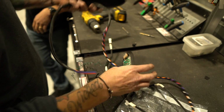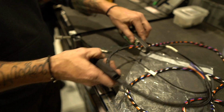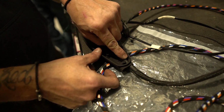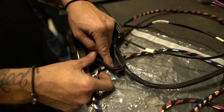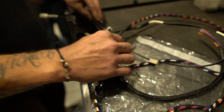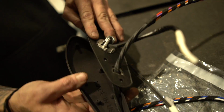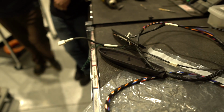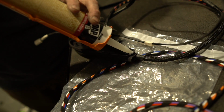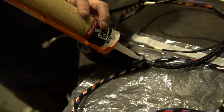Okay. We start to get down to it here. The sealant that you're going to apply, you're really only going to put it around the wire that you ran in and the other hole if you're not using it. That's it. We don't need to apply sealant here because when you bolt the antenna down, the factory gasket actually seals it back to the roof, right? We just use the same silicone that we use for the spacers on the roof. So I'm going to put that down in there.